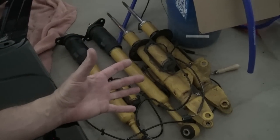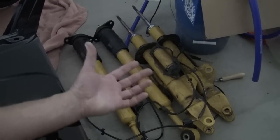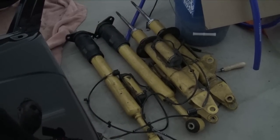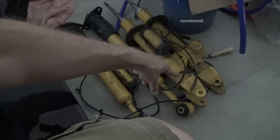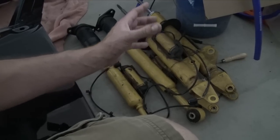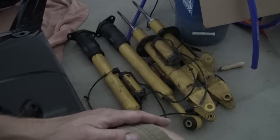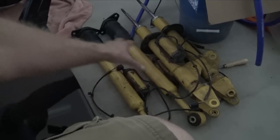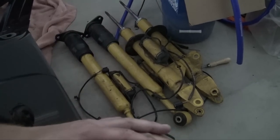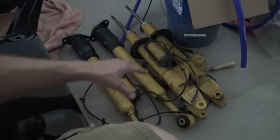So another thing that I ended up getting was 4 Hellcat struts. The reason I got these was because I have to kind of splice between Hellcat and Trackhawk struts. The Trackhawk has a thing on the bottom here, but I need to shorten the strut, because if I have the Trackhawk with that fork, it's way, way too high. And that's what Jose was running into. I forgot to mention it to him, and he was like, oh man, I was breaking my back trying to get this stuff compressed. I was like, oh yeah, the struts are way too long.